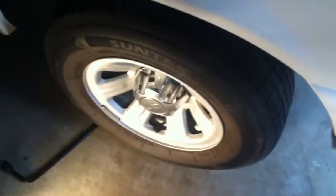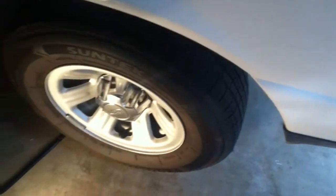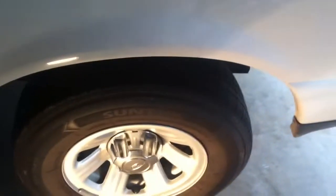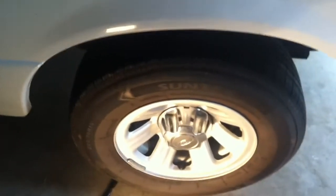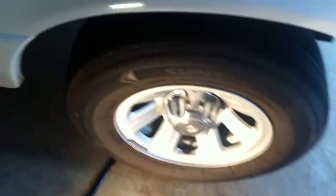Tire rotation after oil change — generally you want to change your oil and rotate your tires preferably within the same day. With a conventional oil, the newer ones you can go up to like 10,000 miles, but for something like this, just a little Ranger, you want to do it between 4 and 6,000 miles. That's generally what I find safe and what my old boss told me at the tire center in Idaho. I rotate my tires every time I change my oil.